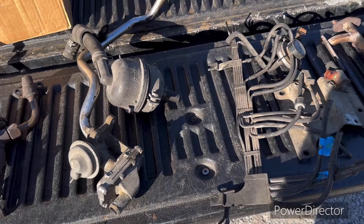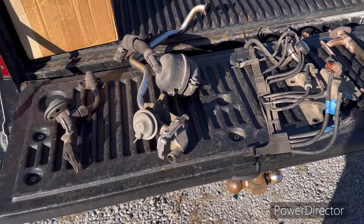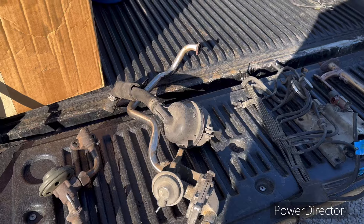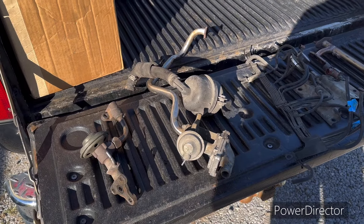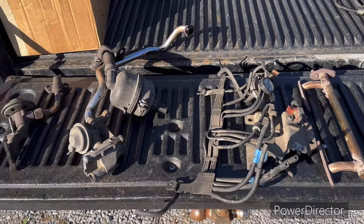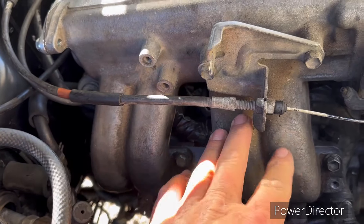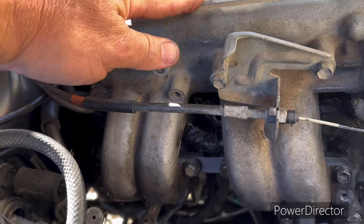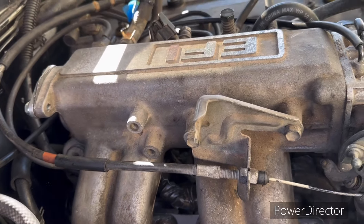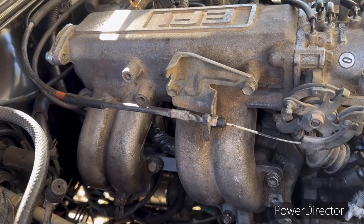Like I say, do your research — this doesn't increase any horsepower whatsoever. You're just going to quit forcing dirty air back into your intake. To be 100% honest, when I took the intake manifold off it was corroded, crusted, black, and dirty inside. It took me forever with water, brushes, and carburetor cleaner to scrub that thing out and try to get all that soot out of the intake. These all four areas right here were a mess. This second half down here that bolts to the head was a mess. Got all that cleaned up — should be a whole lot better now.